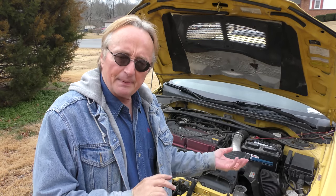This thing is actually pumping bits of raw gasoline out the exhaust. And strangely, when I hook up my scan tools, it has no trouble codes. That shows a number-two problem with Mitsubishis — they've got pretty crappy software. If this were a Toyota running that bad, it would be tripping codes up the wazoo, but this thing isn't tripping any codes; it just shows it's running too rich.